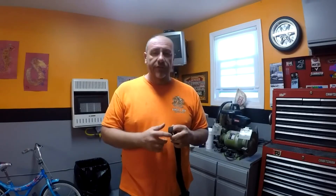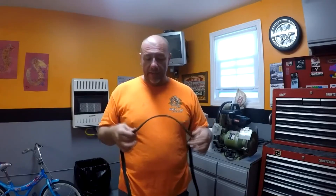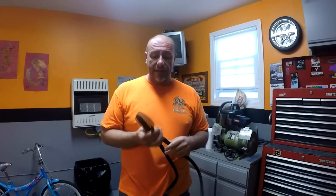Especially the grooves — they're going to wear out, and eventually the belt is going to start squeaking. There are millions of people thinking that stuff is true. If anything, protectant is going to make your belt look nice and shiny. The only bad part about putting protectant on these belts is it can cause them to swell, and it can cause belt failure.